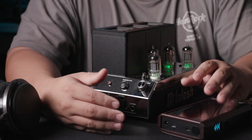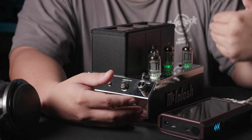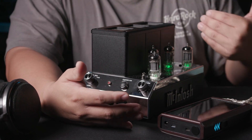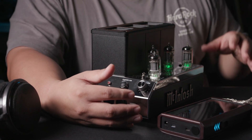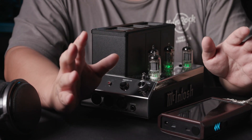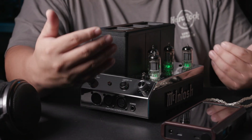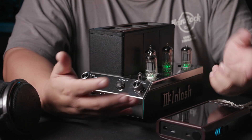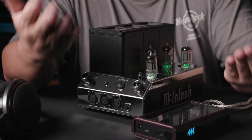Some hardcore supporters and distributors say it's designed this way because it's meant to be controlled through the input from a preamp. This amp takes up to 8 volts in — if you're feeding 8 volts you can leave it at 12 o'clock and it's pretty loud. A deck like the Chord Hugo TT outputs up to 5.8 volts, and when mine comes back from repair I'll test it. For now I'm using the M17, which outputs slightly more than 4 volts without line-out mode, so it works. I do prefer to control the volume using my M17.